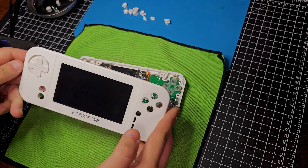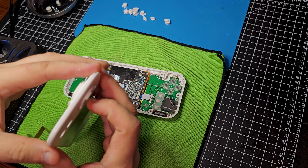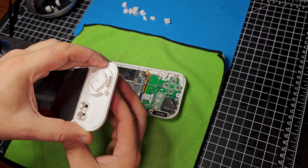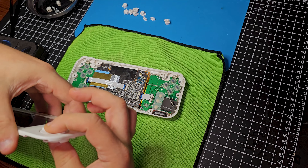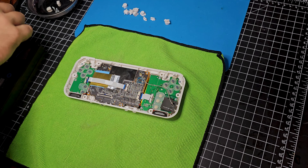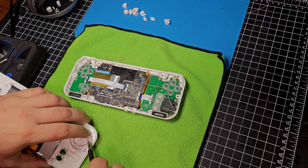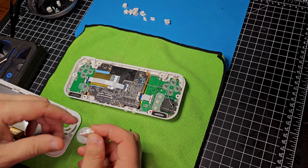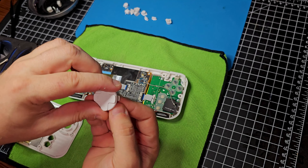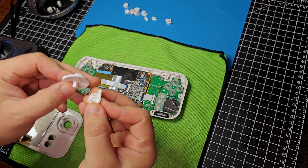Here we have the screen - I'm not going to pull the screen out. And then there's the D-pad. I couldn't figure out before how this was put in there, because this is the same thing as the original Evercade and it's not obvious. I think it's clipped in there. I'm just going to briefly see if I can pry that out. Oh, there it is - that's how it's put together. It's just kind of sandwiched in there. You push it together and that's what grips it. Just pry it apart slowly and it'll come apart.